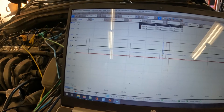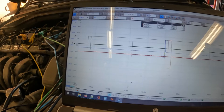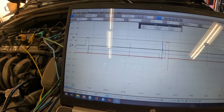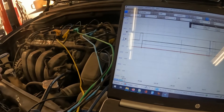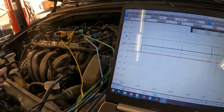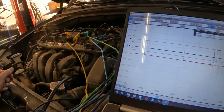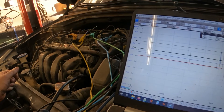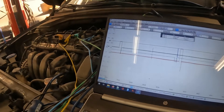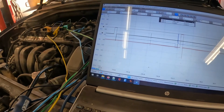What's happening is this isn't the zero-to-five volt square wave the coil is expecting, so that coil is never turning on — it's never seeing this signal because the ground is so elevated. I'm just trying to think: is there any way that could be anything other than a computer for a single coil? Let's go back to running this — I saved this pattern.